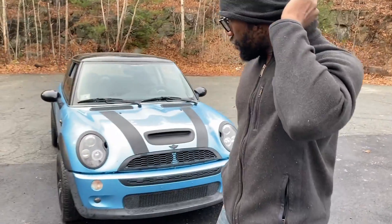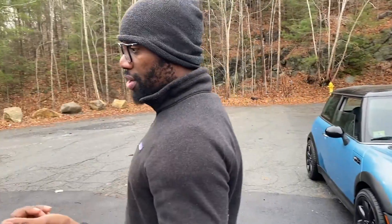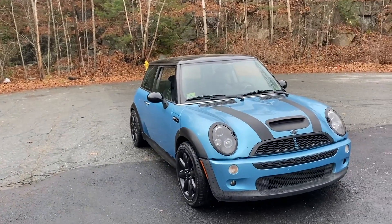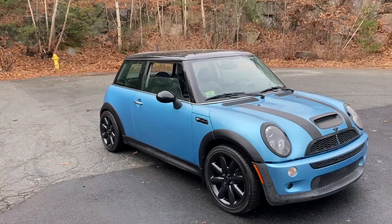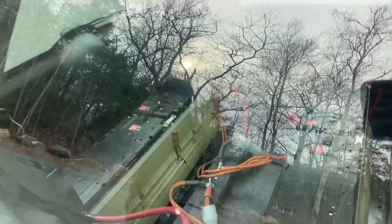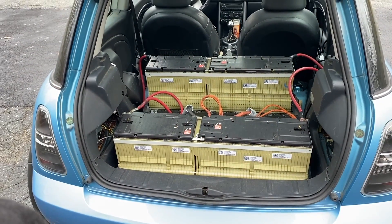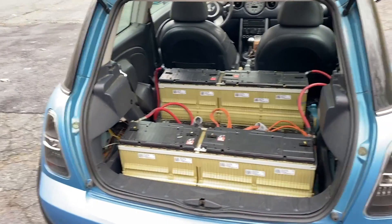The other thing we have to do is figure out the motor mounts, because this electric motor makes more torque initially than the previous motor that was in here before. Things just want to lurch forward — you saw it literally wants to jump out of the engine bay. So we've got to probably add one or two engine mounts to keep it in there. A lot of people were complaining about the lack of a backseat, but this is the way I wanted to do it. For the hot-swapping plan, we need to mount the batteries differently so they're parallel, so when we go for that Lemons race we can pop them out and swap them quickly.